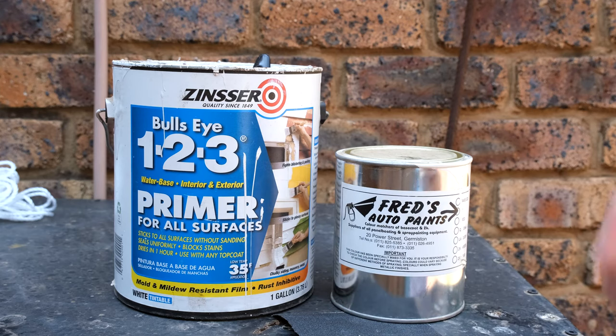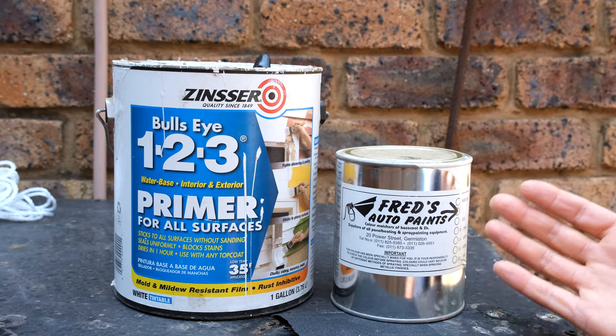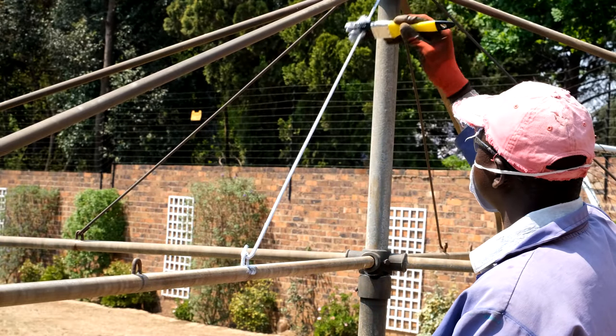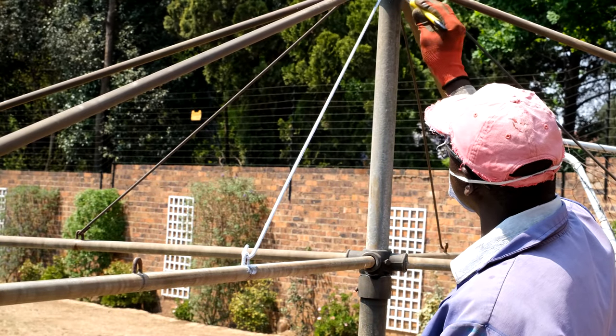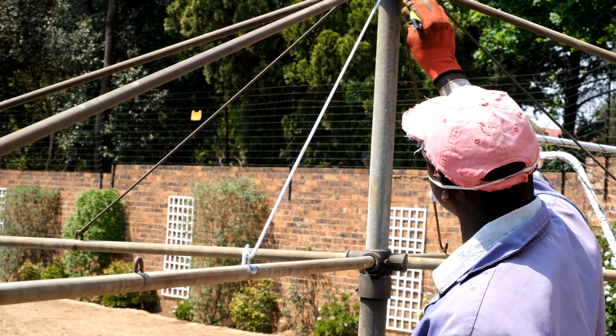You need to put a primer on — I'm going to use a QD automotive paint, but you can use any enamel paint that suits you. Prime the areas that had the most rust first. Obviously the rust has been sanded down, but these are still sensitive areas.